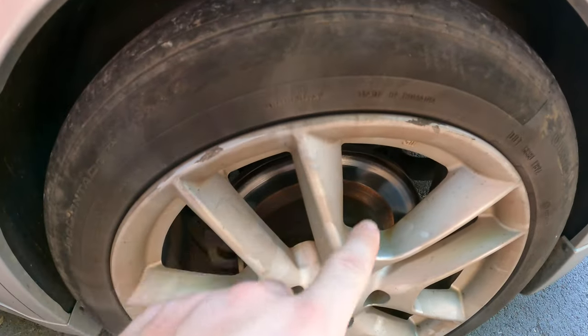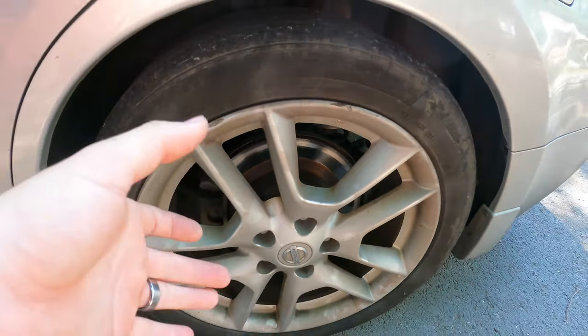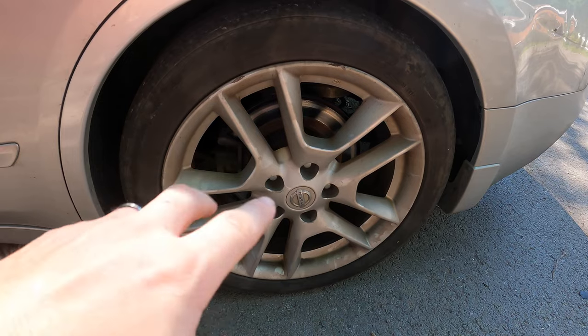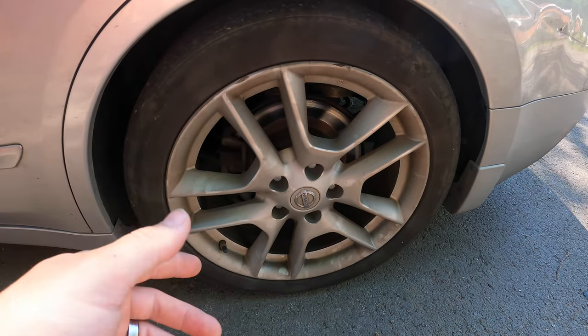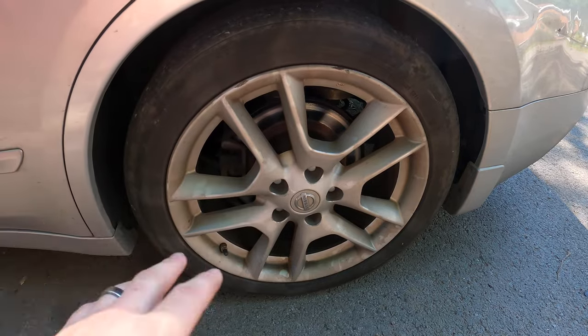I'll run you through all that, but mainly I want to show you guys how the e-brake works on this car. You have the rotor on the back, but inside is a drum, and that inside drum is what the e-brake is. Say you need to replace your e-brake — mine's still fine so I'm not gonna mess with it — but I'll show you what you need to do. I can open it up and show you what it looks like in there. This shouldn't take too long — a brake rotor and pad swap, maybe 45 minutes.